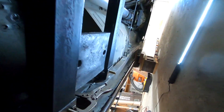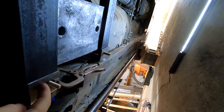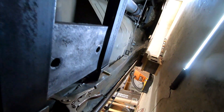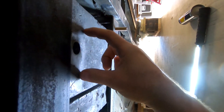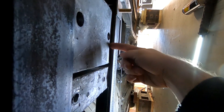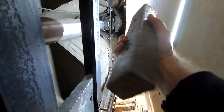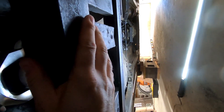Quick update — you can see how everything's coming together. Bolts will obviously go the other way, they're just in there to hold it for now, but you can see how the ballast sits up in there. The shorter fatter ones fit, and what I'm going to do is weld a strip of the real thick 3/16 flat bar across here and utilize the holes that are already in it. The longer skinnier ones make it the whole entire way, so I'll probably just drill a hole in those.